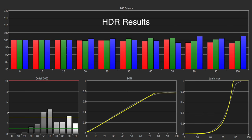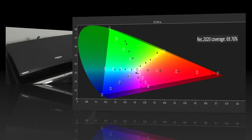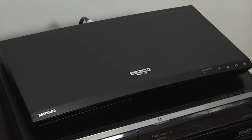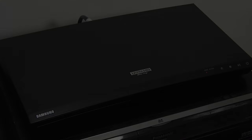The Samsung supports HDR10 with over 1,000 nits of peak brightness. The tracking of the PQ EOTF was excellent as was the grayscale, but like other Samsung HDR TVs the KS7000 tracked DCI-P3 rather than Rec.2020. However, when watching HDR content with Samsung's K8500 Ultra HD Blu-ray player, the results were impressive with detailed and saturated images and a wide dynamic range.